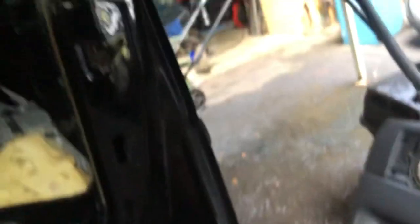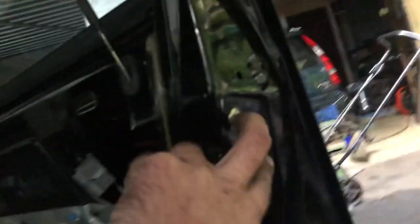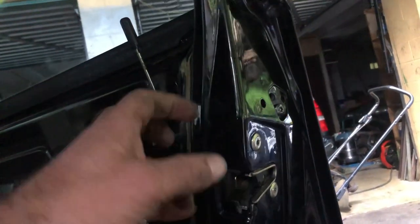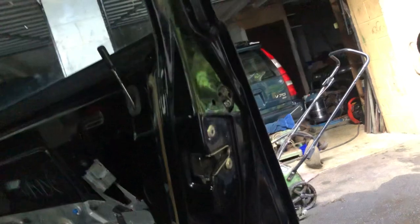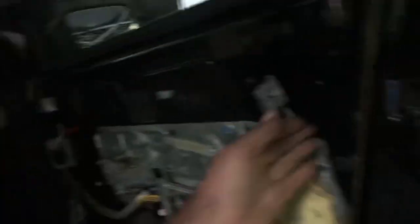The kicker is that your handle has to be in position first, within the door and sitting flat on the door. Then what happens is you release these and move the lock back in a way so that this round part of the mechanism comes in and hooks in behind the latch of the handle.